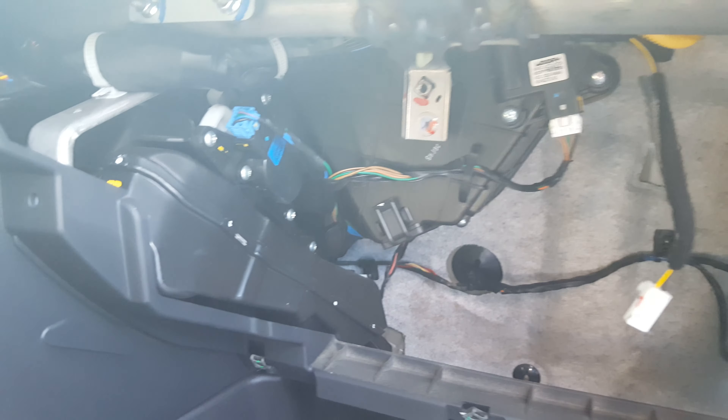When you're looking inside — this is the view looking straight at it — you've got two actuators, one here and one here. If you're trying to find out which one's not working, turn on the climate control and change it from the floor to the defroster to find out which one it is. One will be for your climate control, the AC and heater temperature, and the other will be the one to move airflow down to the floor or to the defroster. That's how you access what they call the blend door actuator on a Kia Soul.